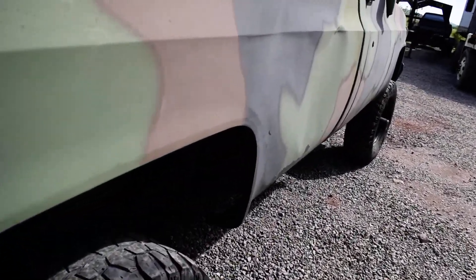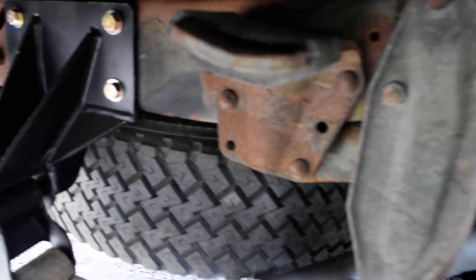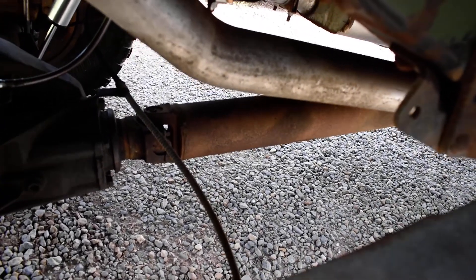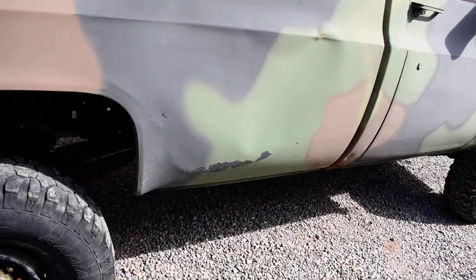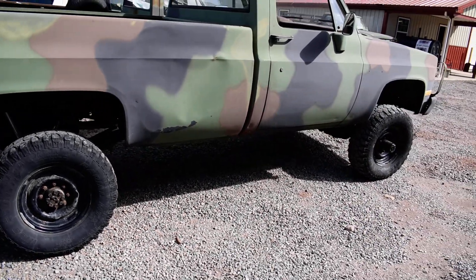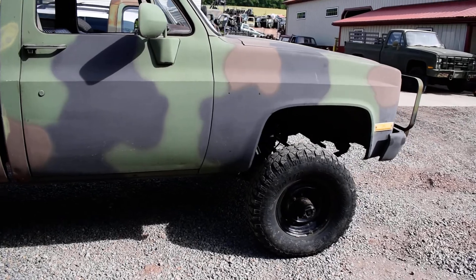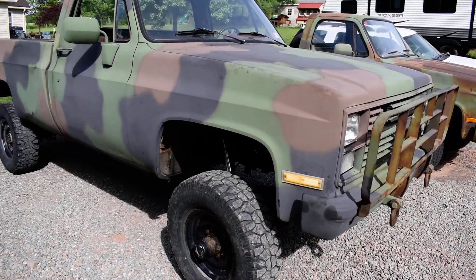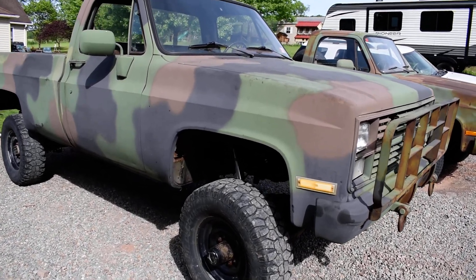Let's see if there's anything else I can show you here about this CUCV and how this shackle system works. Pretty simple componentry, but really nice equipment on this truck — a nice example of a CUCV, a really heavy duty driveline and heavy duty components. This customer's still got the 285-75-16 tires on there; he's going to run about a 35 inch tire on this truck. I thought I'd walk through it real quick for you here on a Sunday morning and give you a chance to look at what those components are. If you've never used them, they're really good components. You can check us out online at hillbillywizard.com if you're looking to have us do this upgrade. Most of these components came from Off-Road Design — those are good guys out there as well.